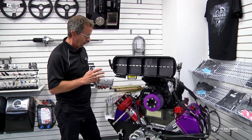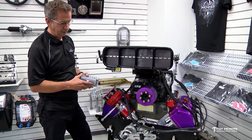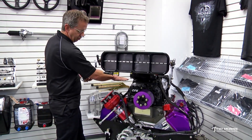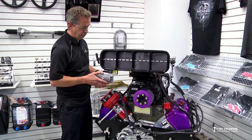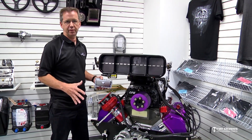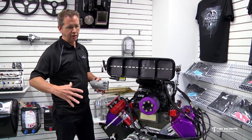When you have a valve issue or rocker arm problem, you get the charge back up into the manifold. That burst panel comes out and without the front end on here you can't tell, but we're gonna fit that front end tight around this blower and cover the mag — so it's all closed in, just allowing clearance for the belt. When this goes on here, 99% of the time it blows the front end off the car — not completely off, but all that percussion from that burst panel coming out is encapsulated under the front end, and it tries to push it off the car.